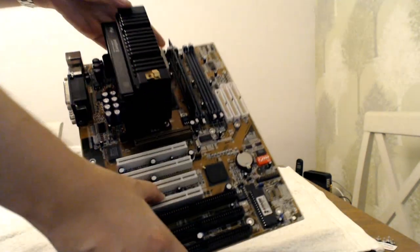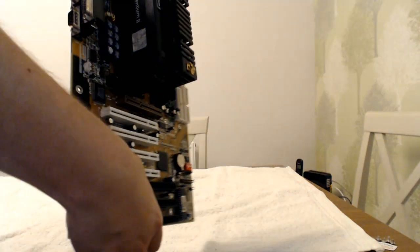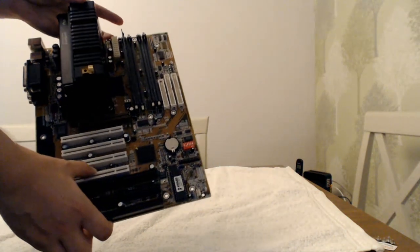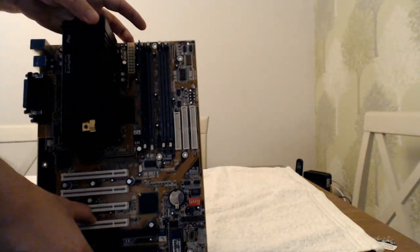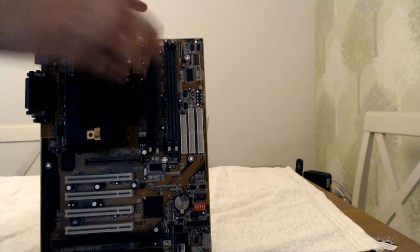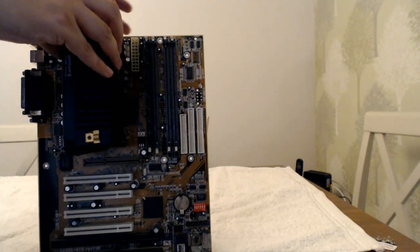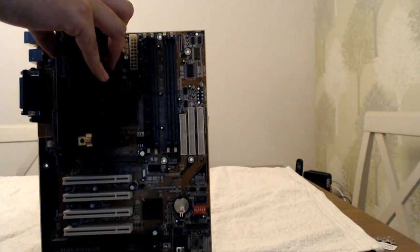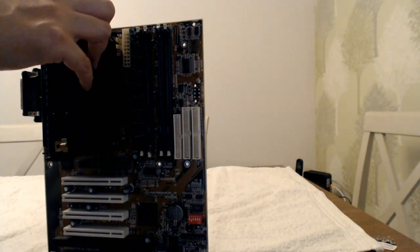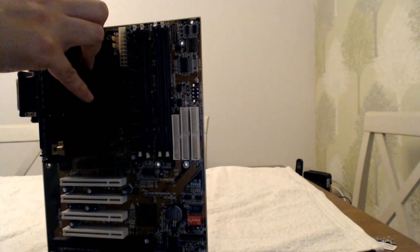Motherboard is out. I've put on the Pentium 2 processor as well. I did that at the same time. It's a Pentium 2 Slot 1 processor, and I've also changed the pins to lower the speed. I'll rest this on the wood. So it's 64 meg of RAM, AGP, PCI and ISA slots on there as well. Got an onboard IDE controller. It's also got two USB slots, which is pretty handy. If you need the CMOS battery, I'll change that as well once it's in the case.